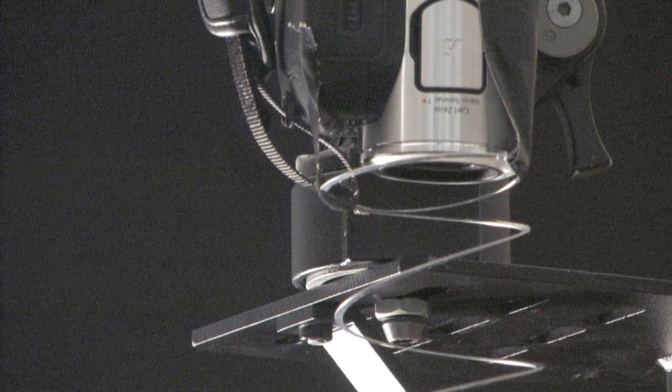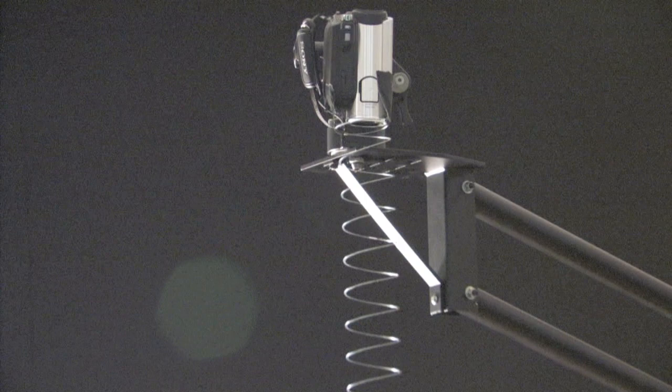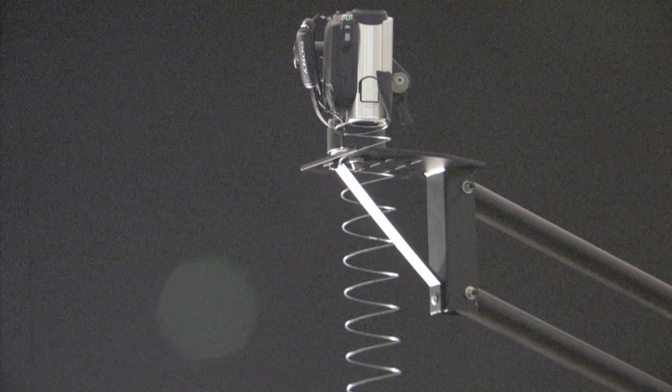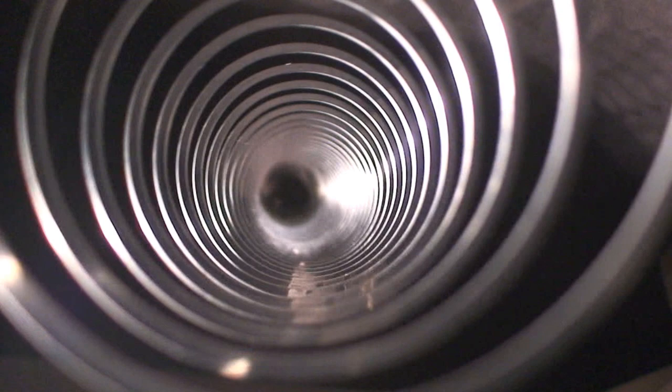You may have used one of these to study waves in your high school physics class. Keep in mind that this is greatly simplified, but it's a good way to visualize what's going on in the exhaust system. Let's say this slinky is your drag pipe — we've suspended it with a camera shooting down into it, and we're also shooting with another camera turned on its side. If I tweak one end of the slinky, a wave travels to the other end and then reflects right back. When your exhaust valves open and a pulse of pressure comes out, the column of air in the pipe acts much the same way as the slinky. That pulse travels down the pipe, and when it reaches the end, the change in impedance from the inside of the pipe to the outside air is enough to reflect some of the pulse right back up the pipe.